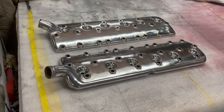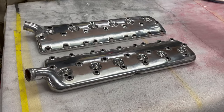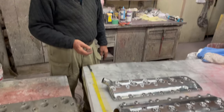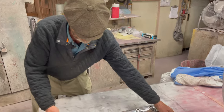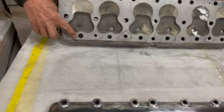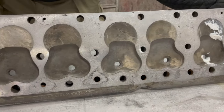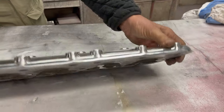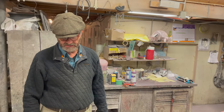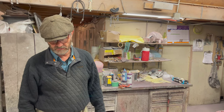Just to make sure I've got it right — these are exactly the same as these, just polished up? Pretty much, only polished. You polished them on the outside, not just the inside. Right — the inside has been decked and faced and machined, and also some welding done. You can see that on these guys here too. This particular one has got a welded area — you can still see a little tiny line in it, but it's all been repaired properly. Usually these are all hogged out from water erosion — that's where people don't put antifreeze in the engines. As a consequence, the water gets after the aluminum. Aluminum is a good material, but you can't put just water in there — there's electrolysis going on, and water is very, very corrosive.